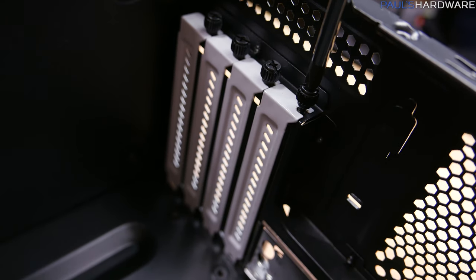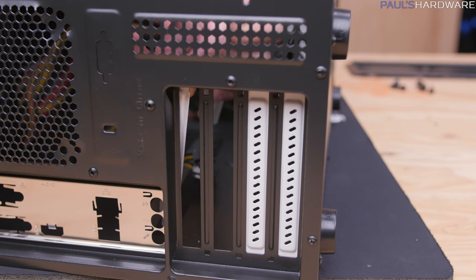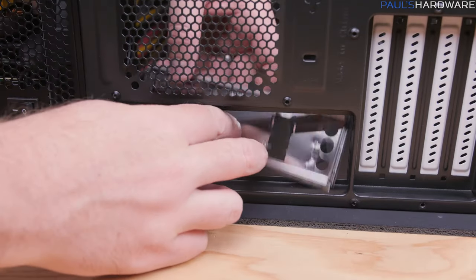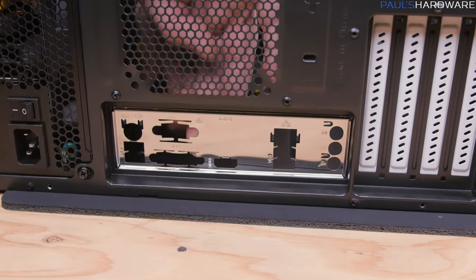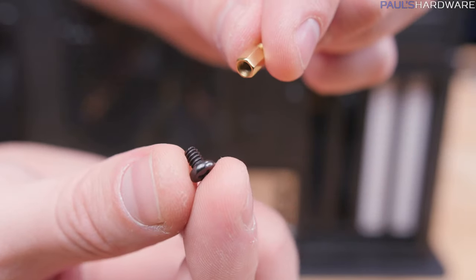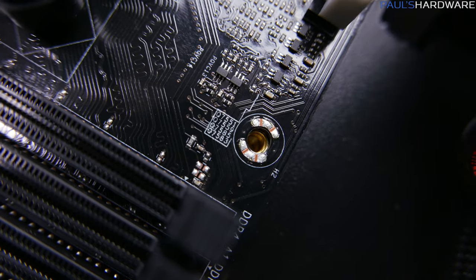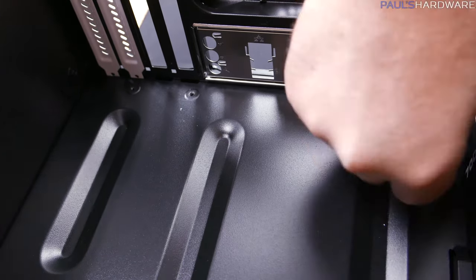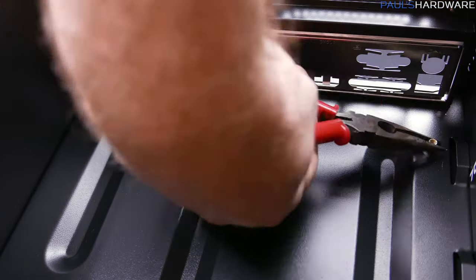While you're at it, finish off that case prep by removing the upper two white expansion slot covers — remember there's no shame in using a screwdriver for a stuck thumb screw — and grab the I/O shield that came with the motherboard and pop it into the rectangle opening below the power supply. Use the butt end of a screwdriver to pop that into place if it's giving you trouble. Next, you'll want motherboard standoffs, so gather eight of these from the case accessories, as well as eight screws of the proper threading to go in each standoff. Your motherboard should have eight mounting holes that correspond with the mounting points in the case. I like to really secure my standoffs with pliers so they won't come loose.